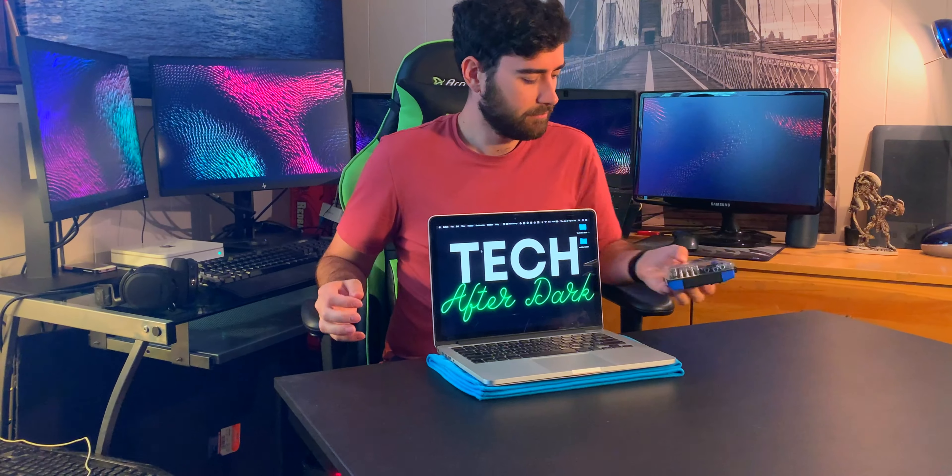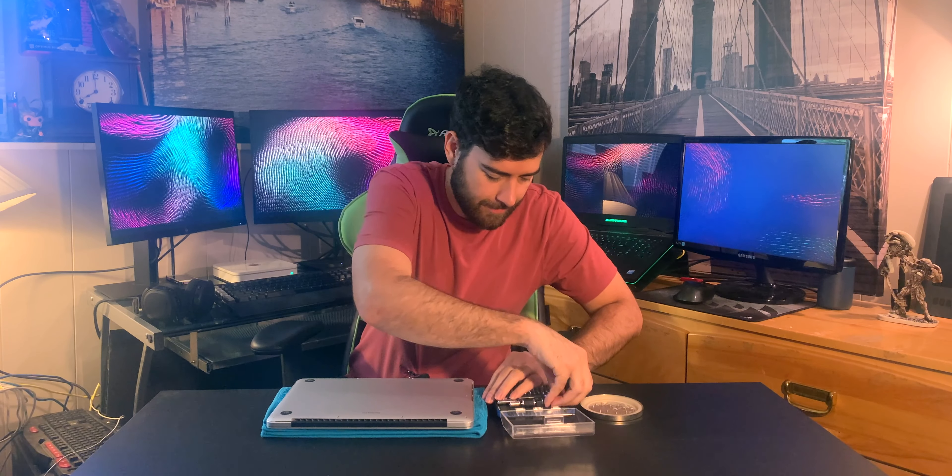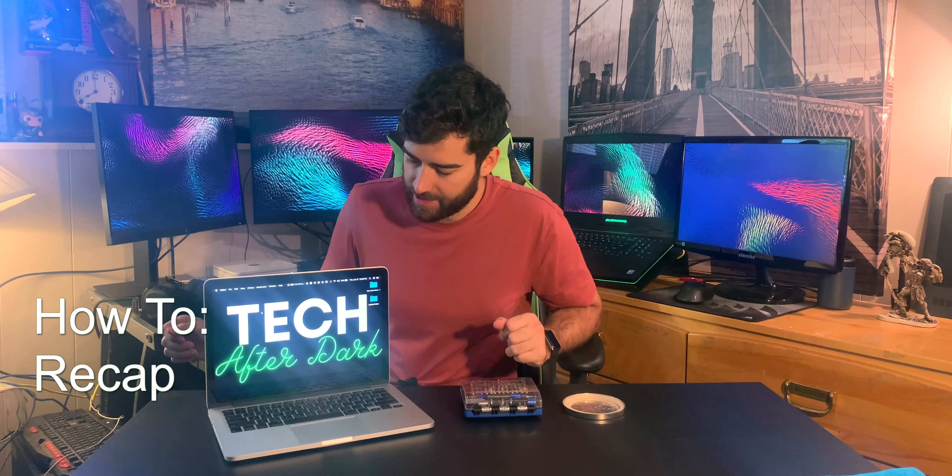Just make sure it never shuts down, otherwise you'll have to do this trick again. Sometimes I even leave the back plate open in case I need to unplug and reconnect the battery just to turn it on. From there you can put all the screws back and carry it around a bit easier. Just like that we've put all the screws back — the laptop will work perfectly, you'll just need a keyboard and mouse for optimal usage. That's how you turn on your MacBook Pro without a keyboard: disconnect the battery and plug in the power cord, and it works like magic.